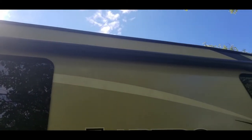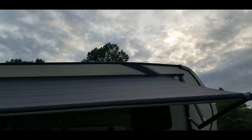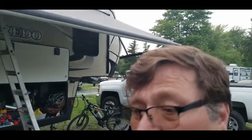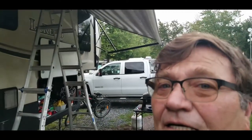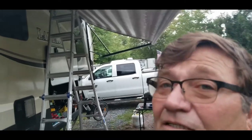And that's protecting it from the sun's UV rays too. So we should be able to squeeze maybe another year or two out of this awning material. That clear awning tape that I bought at Camping World — and that wasn't cheap either — just did not work, it all fell apart and disintegrated. This is what we used. I used three rolls because they're four inches by ten feet, and this is a sixteen foot awning lengthwise. Three rolls at $12 a roll — $36 to fix that is worth it.